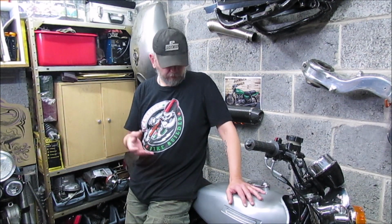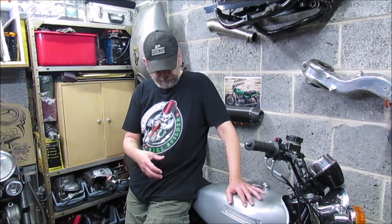Lots and lots of suggestions. One that did stick out that many people said is that it's possible my cam timing is out by 180 degrees. I've spoken to a few people, and it is a mistake that some people have made. It's possible, I don't know. I'm going to have to go back in and have a look. It's something I've overlooked, because I had it at top dead center. I've checked the valve gaps, everything seemed okay, but a gentleman said it's possible I'm on the exhaust stroke rather than the induction stroke.